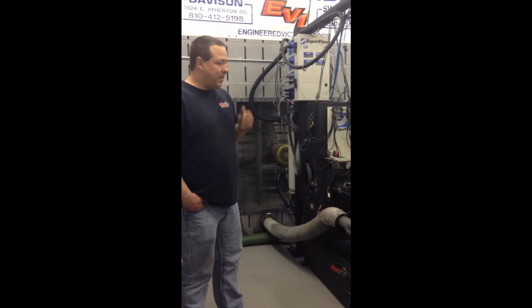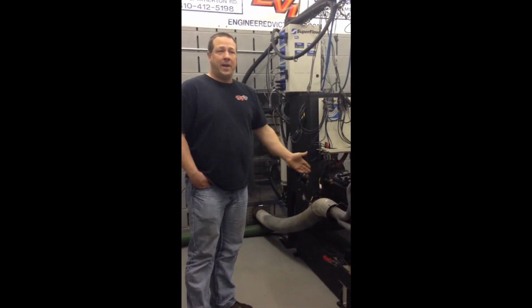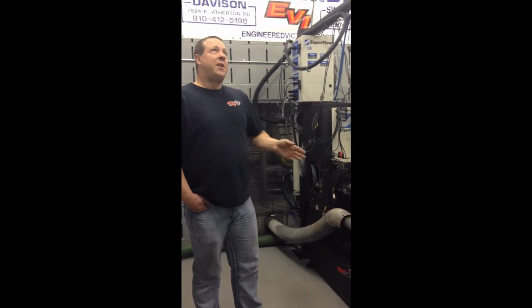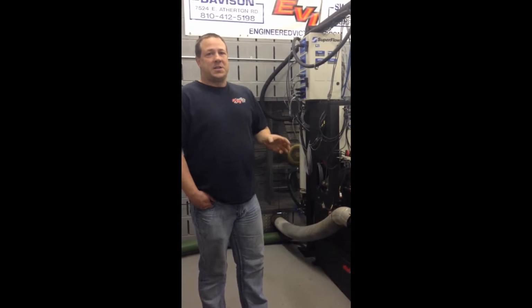Is it starting to come apart? And then you realize that you've just contaminated the room, and 15 horsepower just like that. So once again, it's very important to have a good dyno cell, just as important as it is to have a good dyno. So let me take you into the other room and we'll talk about correction factors and inertia correlation and things like that.